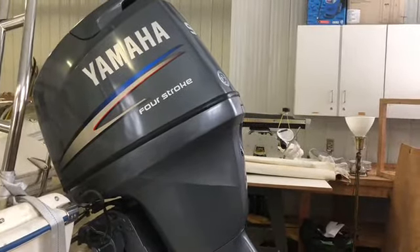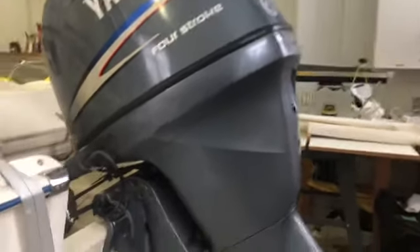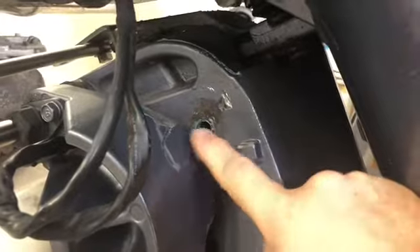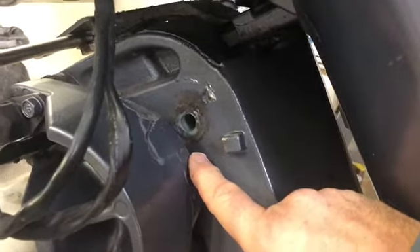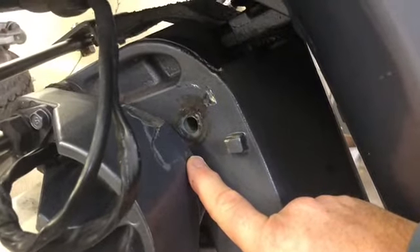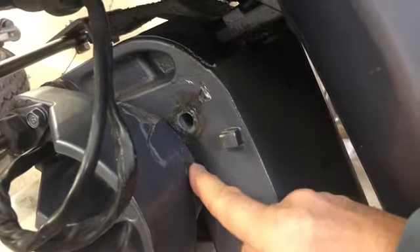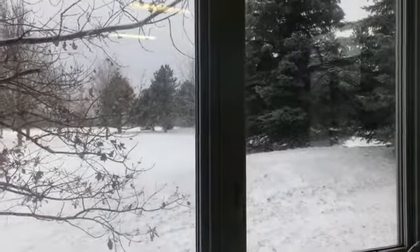Taking your time, everything has worked out. We'll fix this fitting in the spring. The other thing that needs doing - separate video perhaps - is the tilt lock. On these engines my understanding is they're notoriously weak and if you trailer it without a transom saver it will bend and break - and that's what happened. I use a transom saver religiously now. I've straightened that out in the vice at home and I'll replace it when the time comes. Happy New Year everyone - we'll count the days till we can get out on the water again!